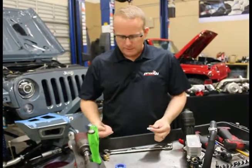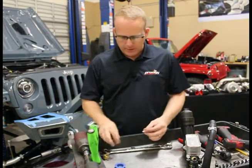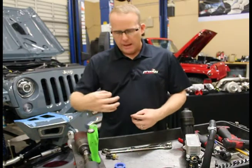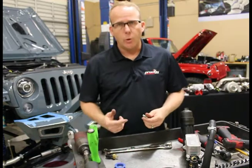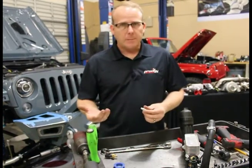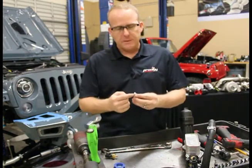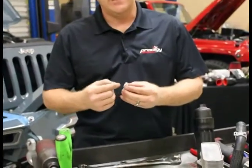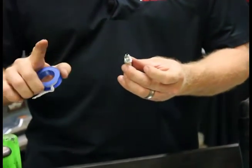The adapter assembly you're going to put together here — in the end we're just going to T in. We're going to put a T fitting, move this out, space it out, put a T — real simple. Then we'll have an AN fitting for our braided stainless line pickup for our turbocharger oil feed line. I want to go over something real quick — it's basic mechanic knowledge. Here's a fitting: the top of it is an AN fitting. AN is Army Navy — it's flared. Teflon tape in a flared fitting doesn't go together. This is MPT — male pipe thread — and that's made for this side.